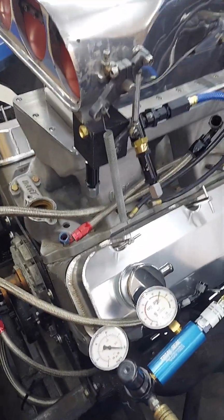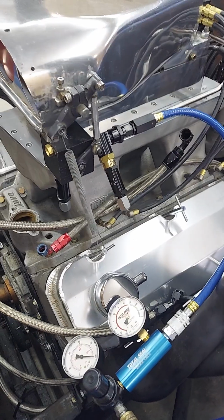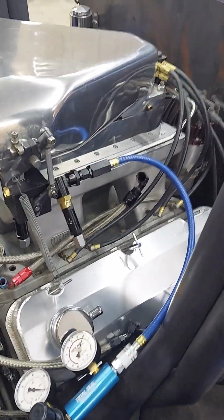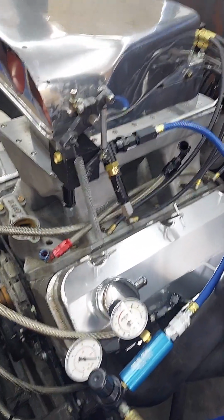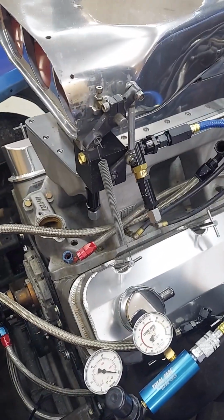The tractor has a huge pump on it, and basically how I set it when I first started is I just blew through the thing to where just barely any air would go through it. Set it up, bam, started right up. These are a lot more temperamental. So that's how you set the metering valve on this.